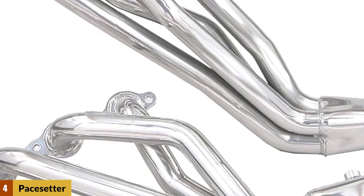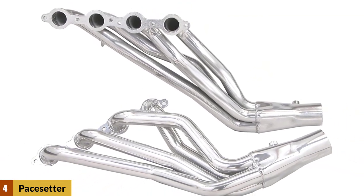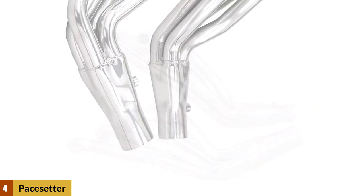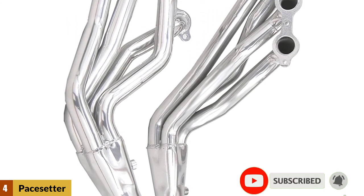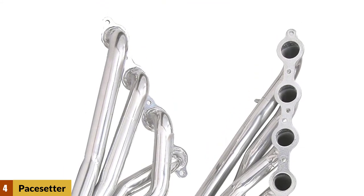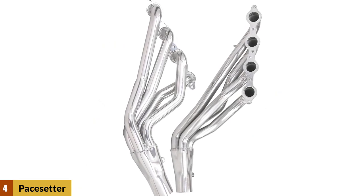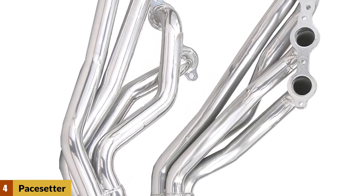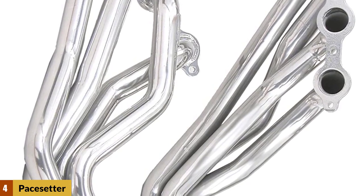The header is then polished for an unequaled show-quality look. By reducing exhaust back pressure and scavenging the cylinders better, these headers provide a noticeable improvement for any application. They feature 3/8-inch thick CNC machined port-matched flanges, 1-3/4-inch primaries entering a three-inch collector, in the proper firing sequence for best cylinder evacuation. Off-road use only. Fits 1999–2006 Chevy Silverado or GMC Sierra 2WD/4WD with 4.8, 5.3, or 6.0L engines. All headers come with gaskets and the necessary fasteners.